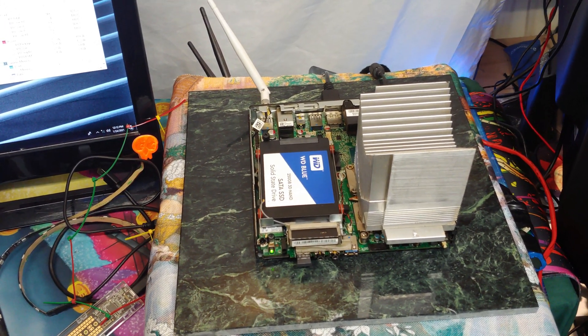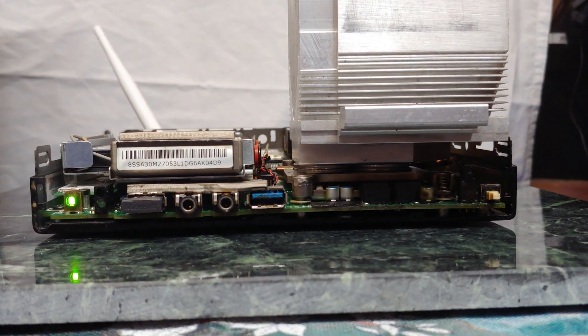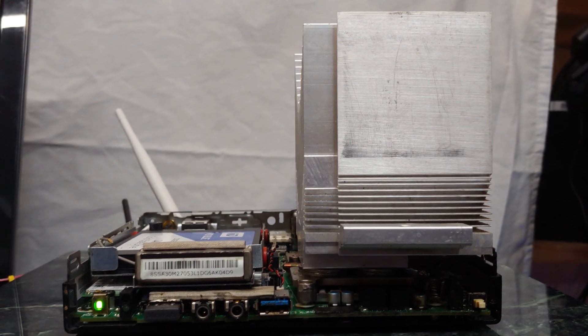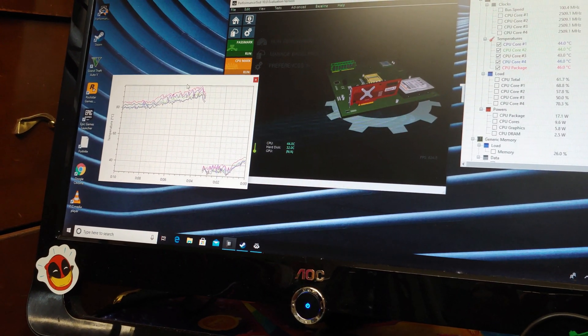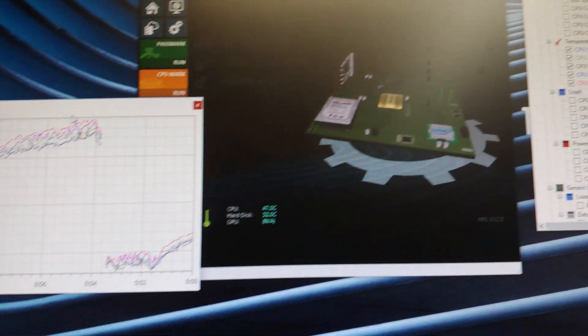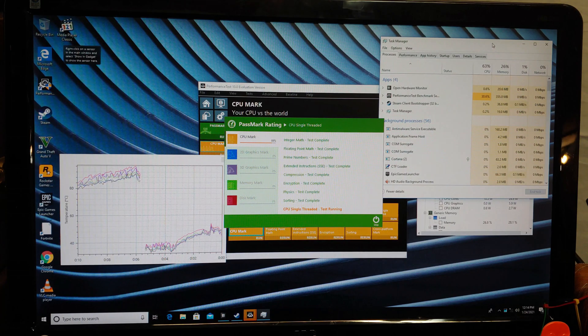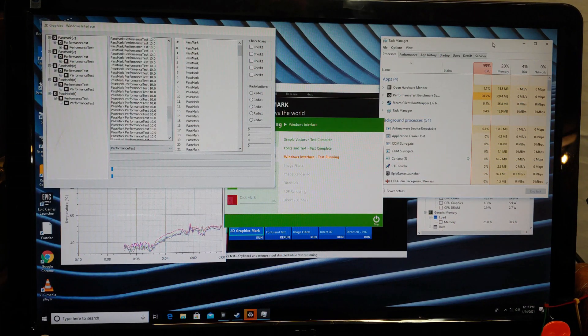Alright, so this is round two. Something I've changed is I've put a marble plate beneath the unit. The whole unit was running really hot. I've sacrificed my godly zip ties, and then I put four quarters down there as a shim so that this heatsink would make better contact. You can definitely see it's healthy — you can see the bar graph, and you can tell within the bar graph where I shut it off. I've turned it on and it still hasn't got as high as quick as it did last time. I used a very special type of paste or glue as a thermal transfer unit between the quarters, the CPU sink, and the CPU. It's called Gorilla Glue — gel, crazy glue type. This crazy glue heat transfer special super T unit is definitely helping out in the score with the temperature.